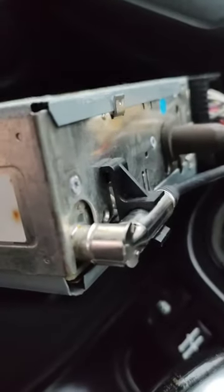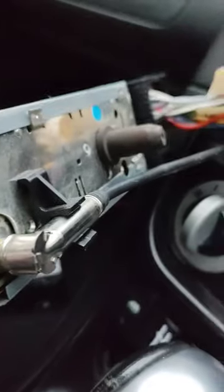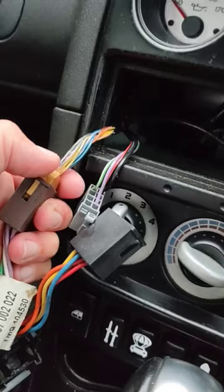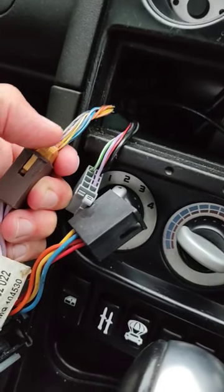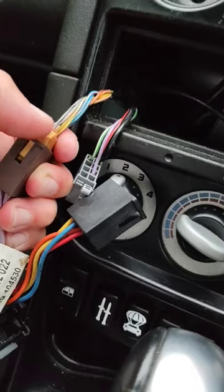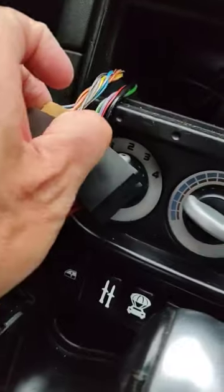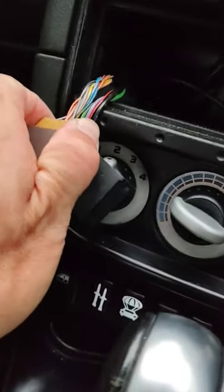In the back of here you'll see the aerial wire and then the plugs. There's a little clip — just pop one off, same with the other side, and the aerial wire just pulls out. To get these out, just push that in like that — same with the other one. Don't pull it out towards you, push it in and they will quite simply just pop out.